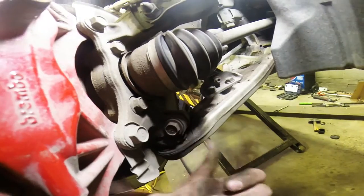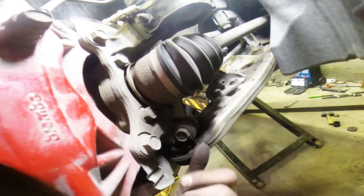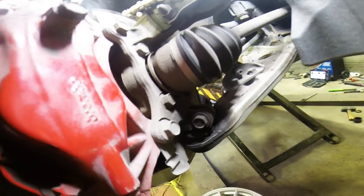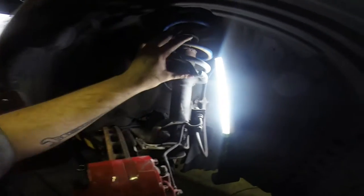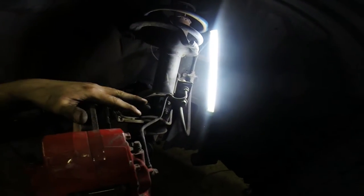This is a 17 on both sides. I'm going to crack this and pull this bolt out. There's a notch in the ball joint. I'm going to slide everything off and you'll see it at the end when I slide everything off, and we'll start on the ball joint removal. Then we'll go ahead and do the coilover: take the three bolts out, take this out, put our coilover back in, put everything back together in reverse.